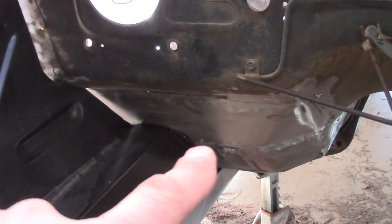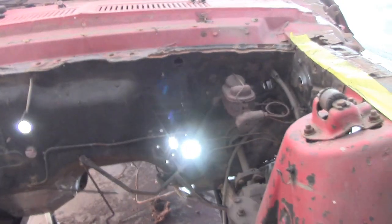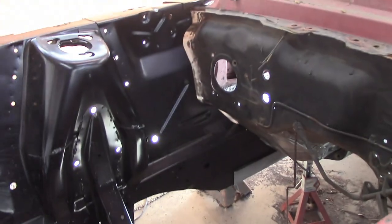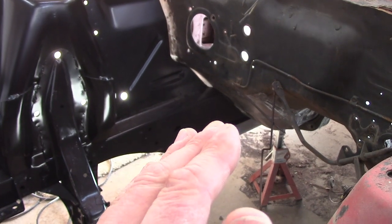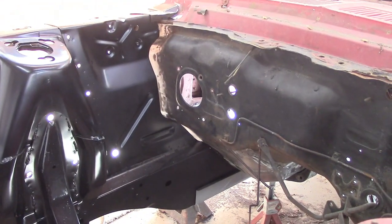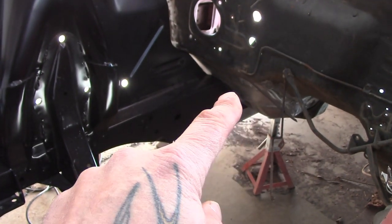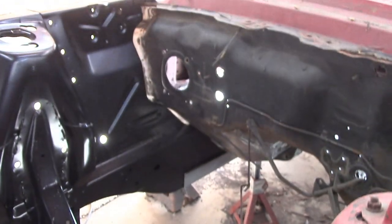So it's never going to go in there because of these pieces. It's not just slip it in and away we go. This is why I didn't just cut the whole front end off and take the rad support out and all that. I wanted to do this one piece at a time. Because this is factory, this is not factory. So it's showing me what's going on here, and it has absolutely nothing to do with the floor. Because the floor pan I replaced — I originally put the floor pan in to the factory inner fender that was there when I did the floor pan. Now I did show you I welded a piece in there where it had been rotten. But the whole lower pan I had replaced way back in other videos, and it was attached to this piece, because I drilled out the spot welds.